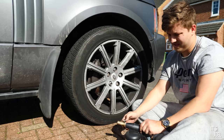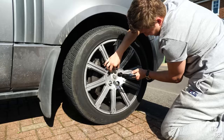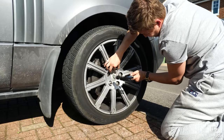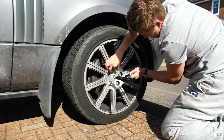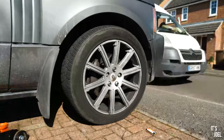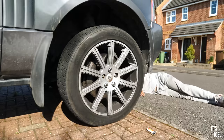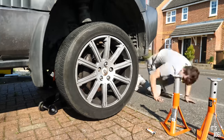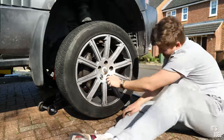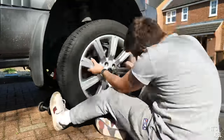But I spent over £300 on trying to get these bloody things off the car, and you should very much feel sorry for me. Although now reading this back, actually, I just sound like a complete idiot, and you probably think I'm a moron. But nonetheless, this same method of removal worked for the other front wheel too. Heat the nut, hammer on a 22mm socket, hard, and repeat on the other two nuts, which needed the same treatment. I'm going to put the car in to have the wheels aligned and balanced, and with that, they should be all done. I think they look great, although I do maybe prefer the old style. For me though, these are on better tyres and in better condition, and so I'm happy.